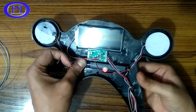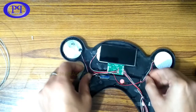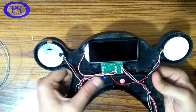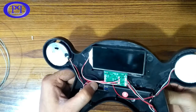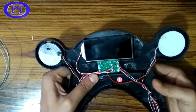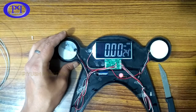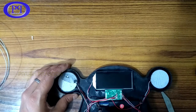I have inserted one battery and the second battery. Let's see if the machine is turning on — and yes it is turning on now. The backlight is also glowing and it is displaying all the seven-segment digits on the display panel. Sometimes it is lagging — I guess there is a connection issue, the spring is not properly fixed. I need to do some soldering on this. Let me check the connection — I insert the battery once again and put the second battery. It is working fine now — it is not going off even if I disturb it a bit.